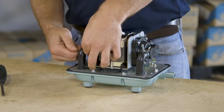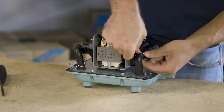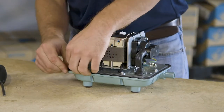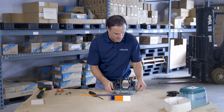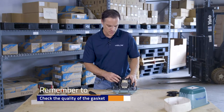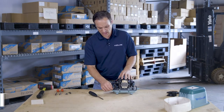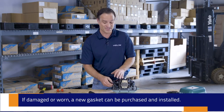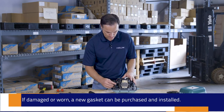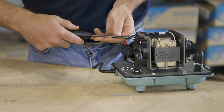The next step is to remove the L-tube on both sides. Pay attention to the bottom gasket as well — it can become brittle with heavy use or in dry or southern climates, and may start falling off or tearing. If it gets bad enough, air can start seeping through that crack and cause performance issues. Once the L-tubes are off, we are going to remove the casing block.